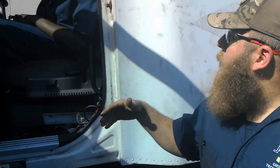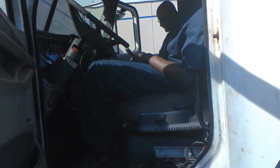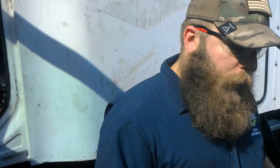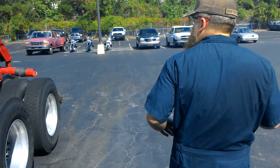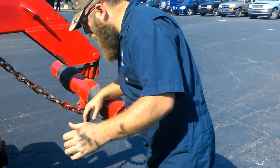Also, you're either going to have a board, or I've got my man Eric up here — he's going to be pushing my brake pedal for me. You want the pressure in the system to be at least 90 to 100 psi. We're going to come back here and I'm going to walk you through checking the free stroke, and I'm also going to walk you through doing applied stroke.